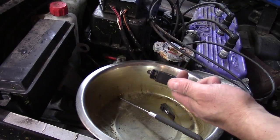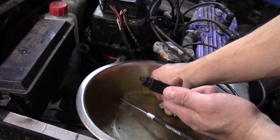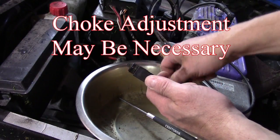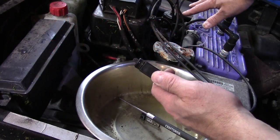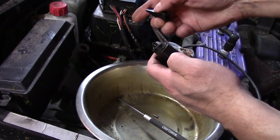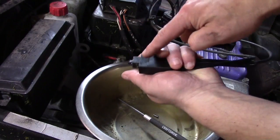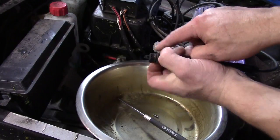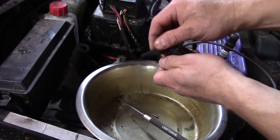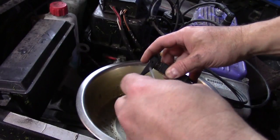This is where it gets a little tricky. I'm doing it over a catch pan so we don't lose our pin. The problem is we don't have enough room to get our pin in because this lever is retracted in too far. I could loosen up all the choke mechanisms on each carburetor, or we could try to take a shortcut. So I'm going to get the lever in the correct position - there's a flat spot that goes in like that, and we want the choke lever to be down. I'm going to take what I like to call a dentist pick and see if I can pry that lever up enough to get it where we want it.